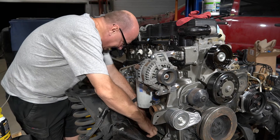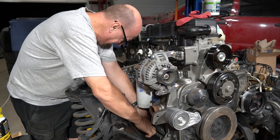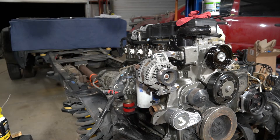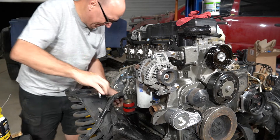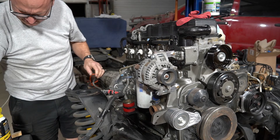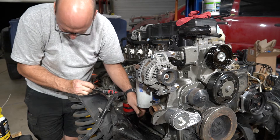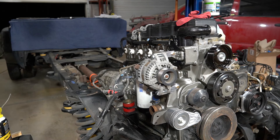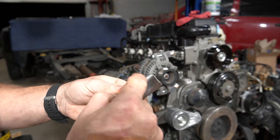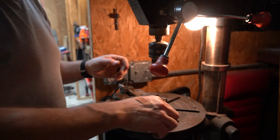All right, it's not touching the oil pan, touching the engine mount, touching the cross member. I'll get a mark - I think I'll use my scribe here. That's where we're going to put the next hole, and that one we're going to drill and tap. I believe the hole in that bracket's a little smaller than an M8 - it's probably an M6. I'll get that set up and keep moving.